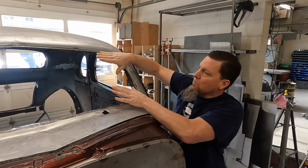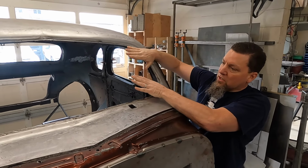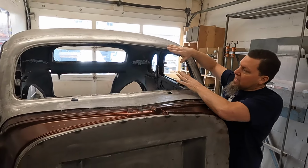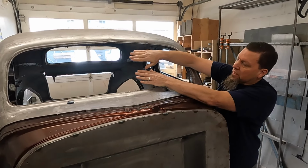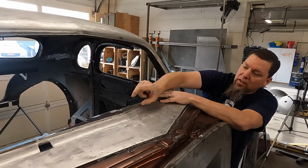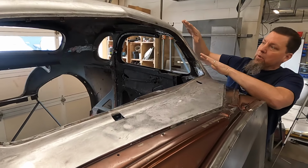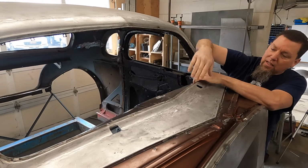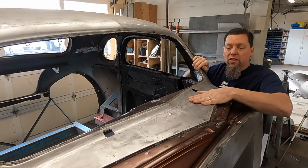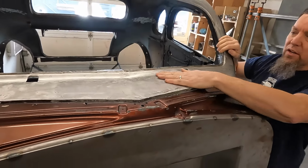And so in order to get the windshield all welded back in the same plane, we actually made a metal windshield. We'll pop that in here in a minute and show it to you. It came in the original shape, and we were able to cut that apart and slide down the distance we needed to bring the windshield frame down to the cowl itself. At that point, we were able to cleco that piece in and then build the cowl back together. I guess we did also cut out the cowl vent and got it filled. And granted, all this stuff's just kind of roughed in right now.